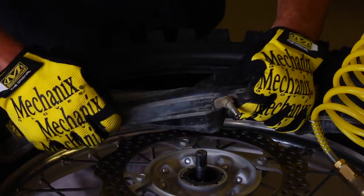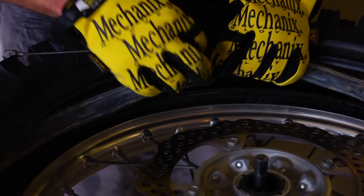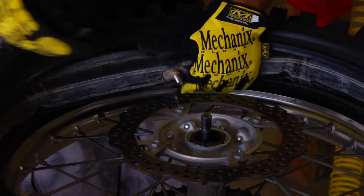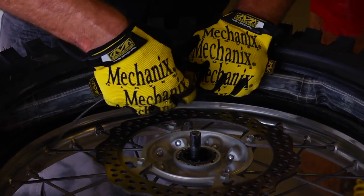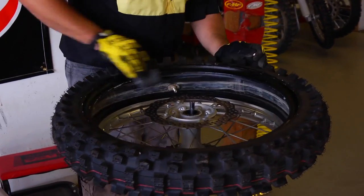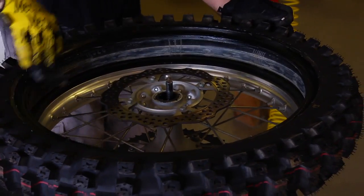At this point I put the tube all the way inside the tire, which is a step a lot of people aren't used to, but if you get used to it it's a lot easier. Put the valve core in the stem and tighten that back down. It's a good idea to put the tire out in the sun for a bit if you like — get it a little softer, easier to work with. I've got a little too much air in here so I'm going to let a little air out of the tube; it needs to just hold it just a little bit firm, you don't want too much air in there. So at this point we're going to lube up the tire with some tire paste — any automotive type tire paste is better than soap and water or anything else, because it stays slippery and then dries nice and tacky. Get it all on there really nice.